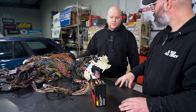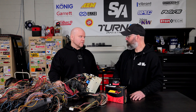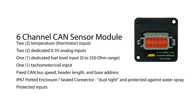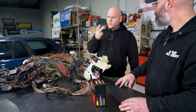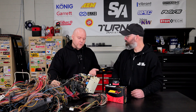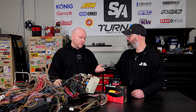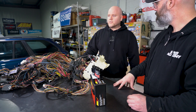I will show how you can nicely integrate this with the rest of AEM's gear. You can have it showing up on the CD7 because it's communicating its state over CAN bus — so it's not just receiving data, it's sending it back. And combine that with something like AEM's six-channel CAN bus module and you can have a bunch of sensors in the trunk as well that also transmit data back over the same two wires. So you have a bunch of sensors, everything is powered and grounded in the trunk, and the data is going back over two little wires. You don't need a massive wiring harness anymore. The old approach is dumb — it can't send you a warning light unless it's wired in. You blow a fuse and you have to get the tester out to figure out which one. With this, you just open your diagnostic page on the CD7 or your laptop and it tells you exactly which output is broken. Amazing troubleshooting.